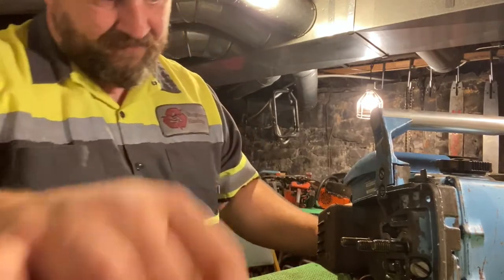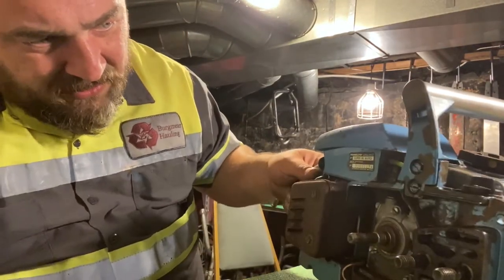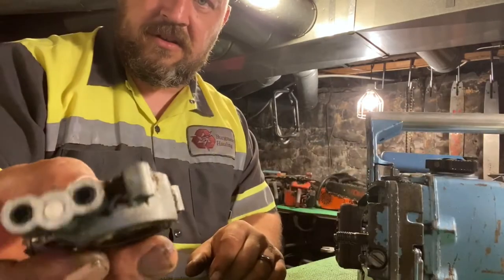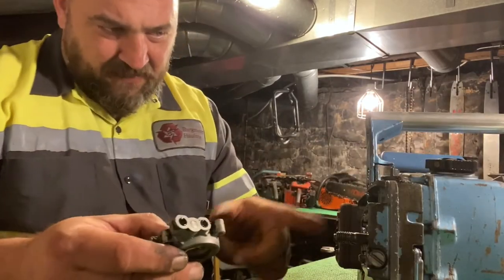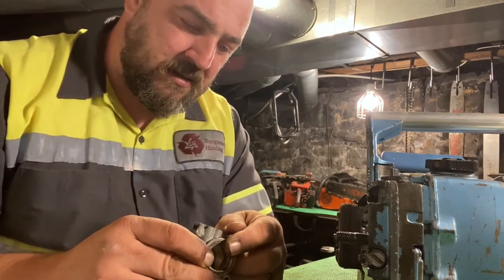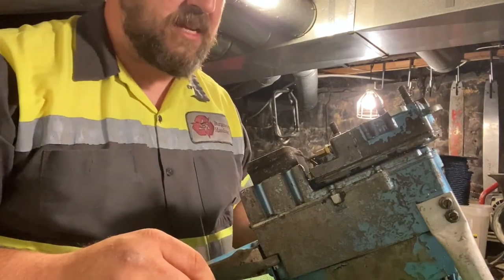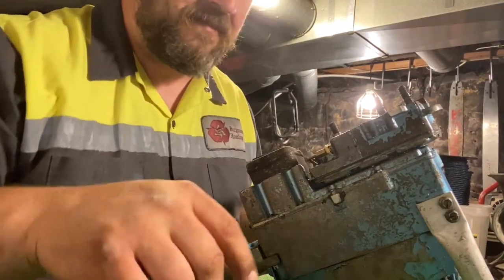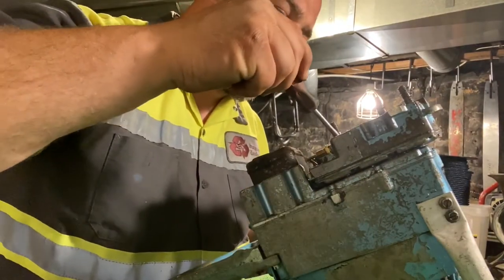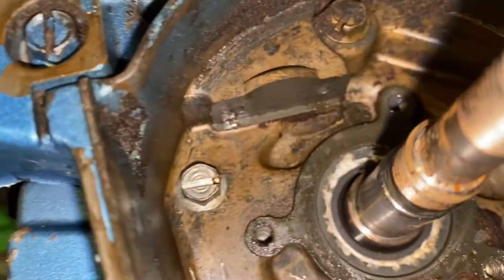Clutch looks good. Down to the oil pump — there are two o-rings in there. If you notice a bunch of leakage in here, replace those o-rings. That crankshaft seal is not pretty. There's what our crankshaft seal looks like.